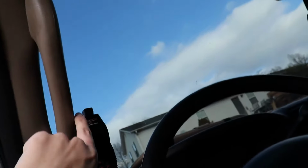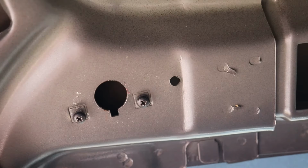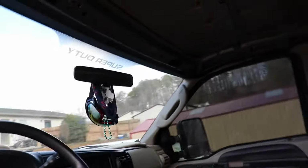After you get your headliner dropped down, I think they recommend pulling just the two bolts out of these over there. All you have to do is pull those two bolts and then pop off those pieces right there, and then you can pull down the headliner. Of course, there's two Phillips screws on the sun visor as well, on each side of the sun visor. So once you get that removed,